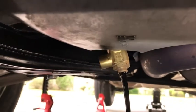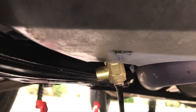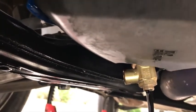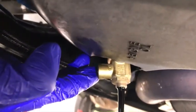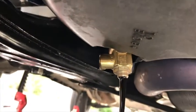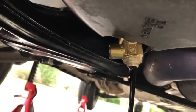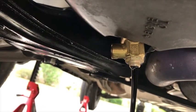If you don't know about Fumoto valves — it's spelled F-U-M-O-T-O — it prevents you from having to take out your drain bolt. Once you install it, all you have to do is what I just showed you. After the oil is drained, push in on the spring-loaded valve and rotate it 90 degrees and it'll be closed. Then we'll put in our oil, which is 5.7 quarts, and that's going to complete our oil change.